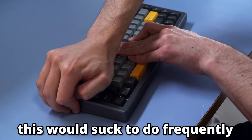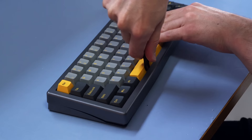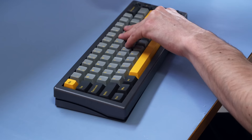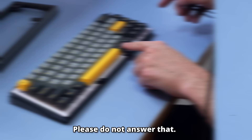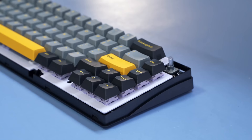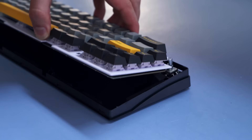The method I found to be easiest to open this thing was using tweezers and just absolutely forcing the case open, which did damage the keycaps a little bit, so it might be best to take some of those keycaps off first. This was significantly more effective than the guitar pick method, which I tried for like 20 minutes. But what's not stupid is these gaskets, which are very, very pillowy. Some people don't like side gaskets, so you could always tear those off. The plastic case has an almost metal finish, so you could fool yourself, I guess. Most interesting is that the gasket cutouts on the plate are really big — most of this board is having gasket contact, which is probably why you don't get that much plastic noise typing on this case.